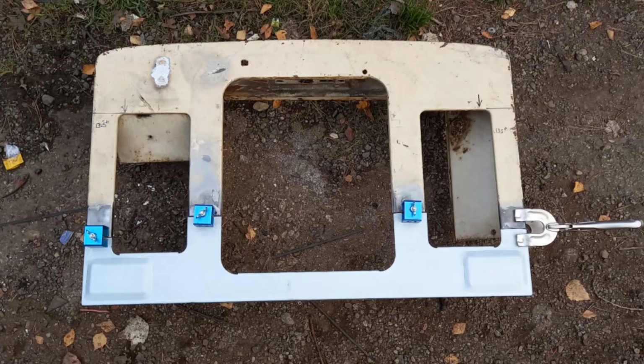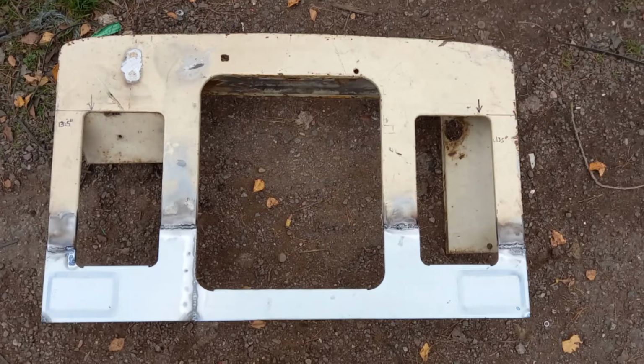So once this is all in, the next step is to actually remove them. So in order to remove them to weld up, what you've got to do is put a tack either side of the panel clamp or you're fixing, and then also around the edge on that where it turns 90 degrees either side, where it bolts to the wing, tack everything so it holds it square when you remove the fixings. And when you start to weld, it'll make sure that it doesn't pull. So in the next clip, we're going to see everything welded up.